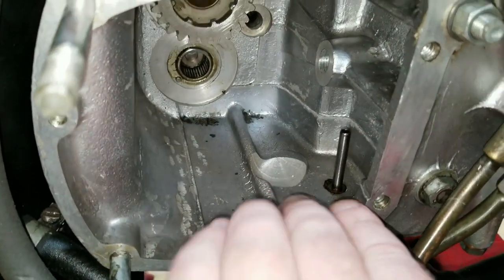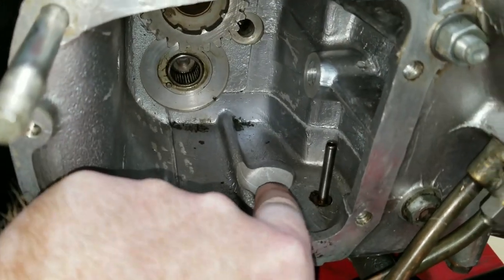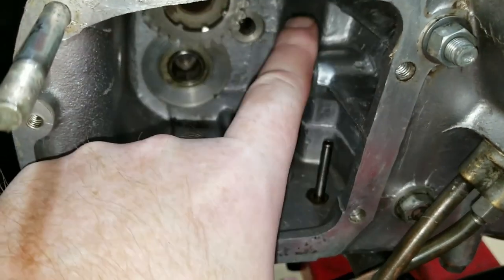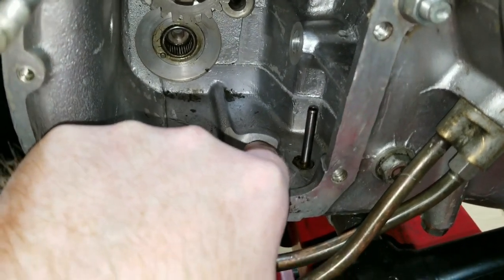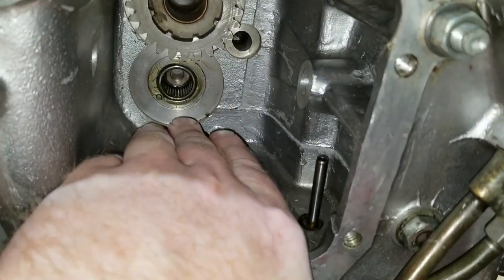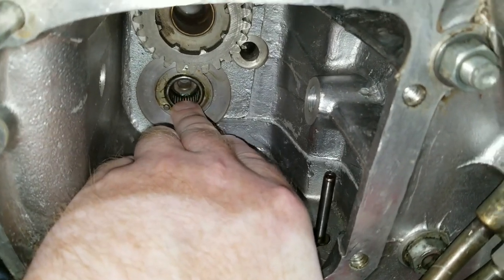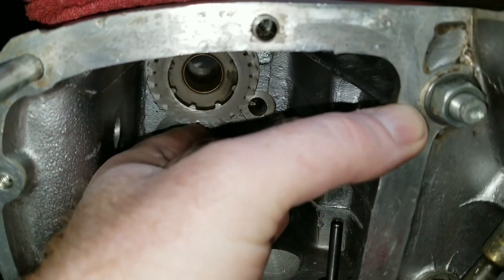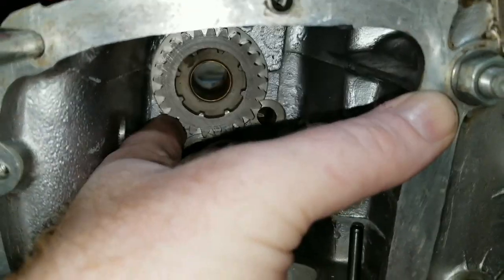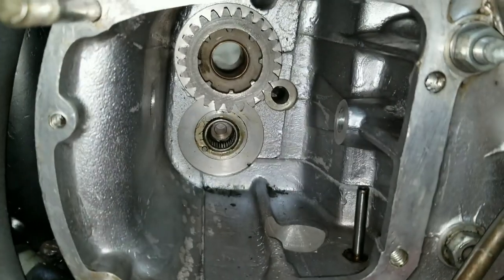What we've got going on here is there's a little divot that's been machined out, originally from the factory, which allows the index unit to clear stuff in here and shift freely. This bearing down here for the lay shaft is in good shape, and our fourth gear turns freely and is very nice and smooth.